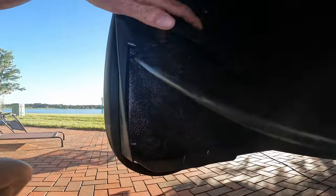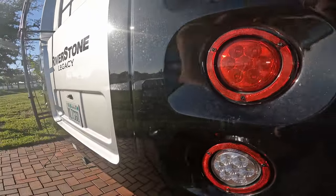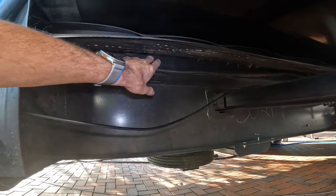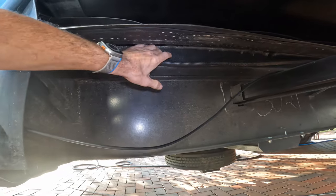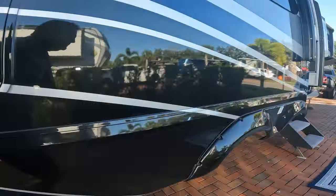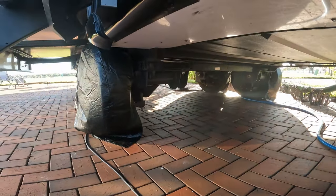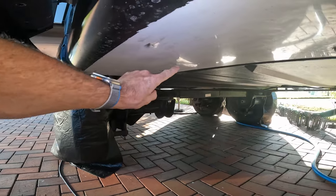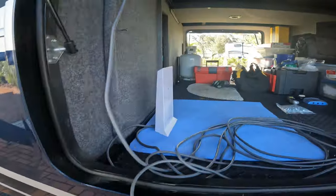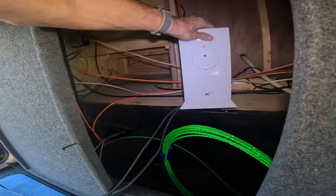I ran a fish tape in here and tried to get around the corner but couldn't, so I took this light off and just fished it through manually, grabbed it with my hand and pulled it through. This is just a dry run to get the route right. I will get some corrugated split sleeve and mount it up here — this is aluminum underneath so I've got some fasteners. Once I get up around here I'll bring it through that hole with corrugated again, then bring it up through there, which ultimately comes up here where I already have it run.